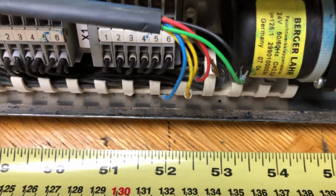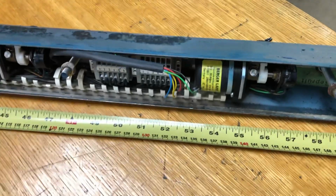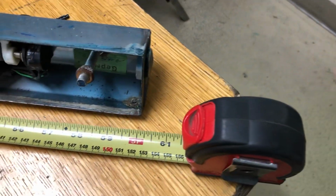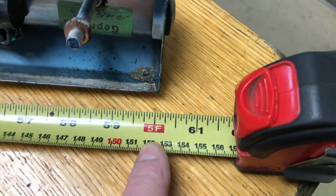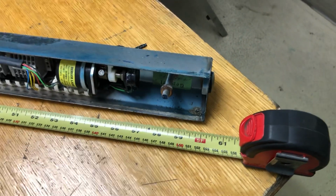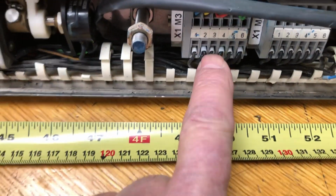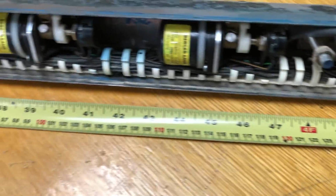53 inches, I guess. But I was talking to my electrician, and he was saying if you can extend the whole harness about a foot after the end right here, okay, so you got 5 feet. So if you make the harness 6 feet long and keep all the wires the same length, 6 feet, then he will clean it up and put these ends on your harness. And that should do it.